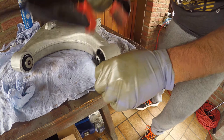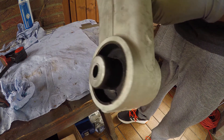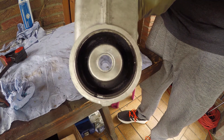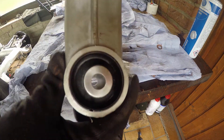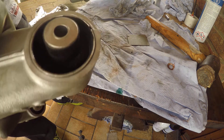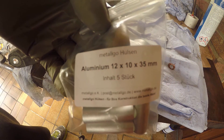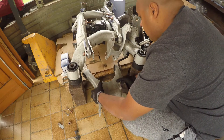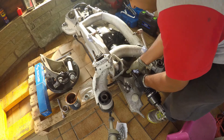What you don't see here are the many sleepless nights I had trying to figure this out — looking for somebody to lend me a set of vernier calipers, looking for somebody to lend me a lathe, asking nicely at the scrap yard if they had any aluminium, and telling my wife she might have to give up the car and get on her bike. In the end I was rescued by an online company that makes these sleeves in their thousands, and for less than 10 euro I was able to make these E53 bushings compatible for the E39 and ready to be installed back into the subframe. With the wishbones re-bushed, unfortunately that means this episode has to come to an end — but it also means in the next episode we actually finish the rebuild of the subframe. So thanks for watching and see you next time.